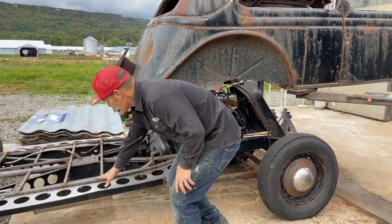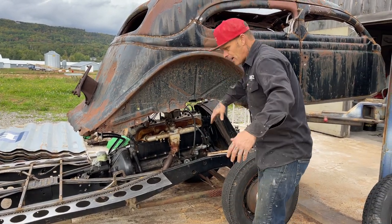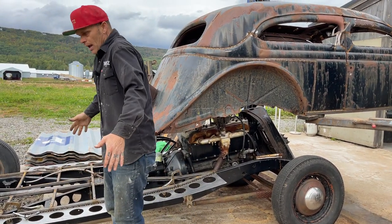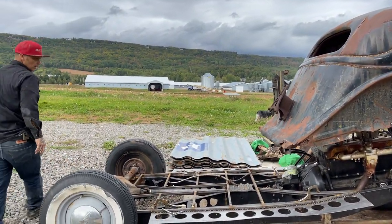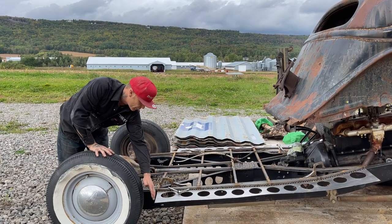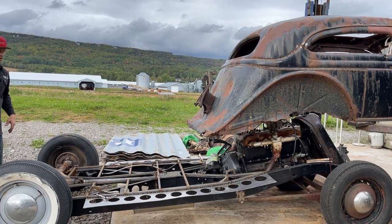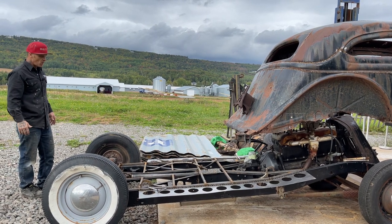On the floor, I'm going to try to use aluminum again to make it as light as possible — trying to make all the floor pans out of aluminum. But this part right here, as this is welded on, the outside sill with all these holes in it — basically they're there to hold the car from going apart. The A-pillar and B-pillar have braces on them that are going to sit on this part, and the outside sill is going to hold onto the outside square tubing.